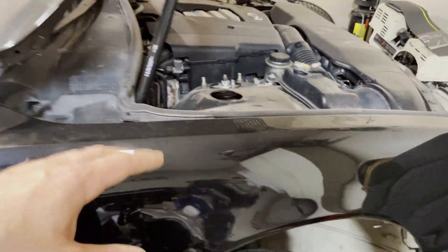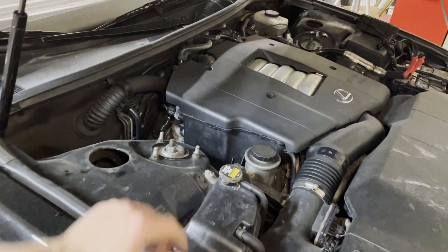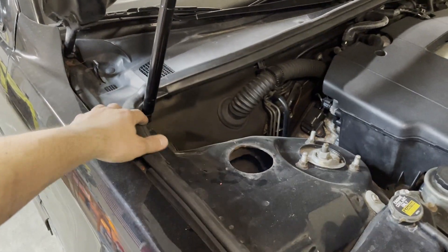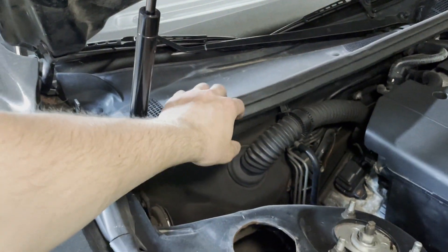Get the brakes checked out, check the pad lining, and do an oil change — it's been overdue. These have to get welded in on a car like this, so we're gonna make some pucks that fit in here, weld it all nicely, and put all new clips on for these seals.